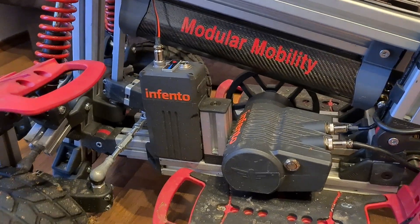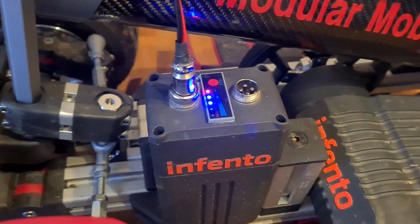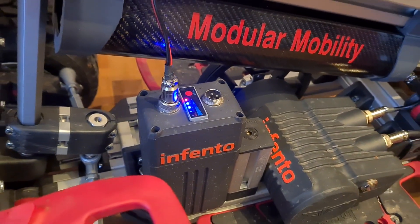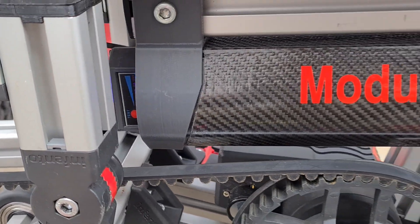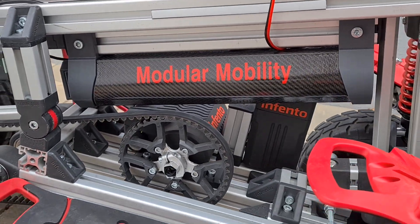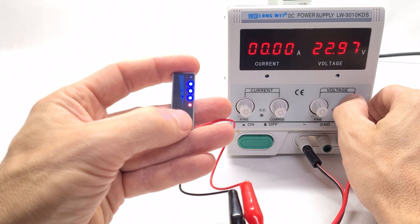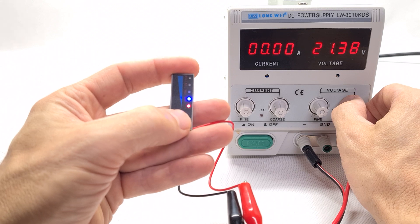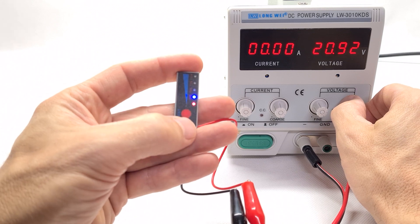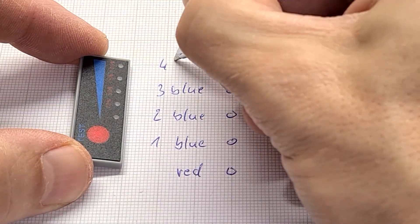The indicator panel measures the battery's idle voltage, so you can only expect meaningful values when the battery is not under load. Values displayed while driving will be misleading. I was curious about the voltage levels corresponding to the five different LEDs, so I connected it to my laboratory power supply and varied the voltage — the LEDs went out subsequently as expected while reducing voltage, and I recorded the threshold results.